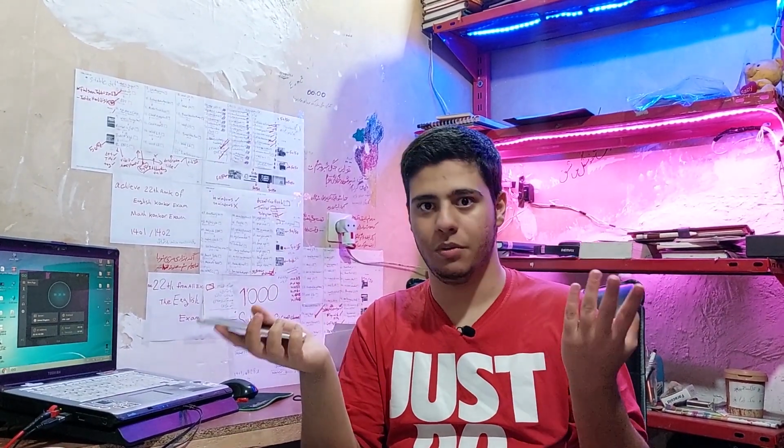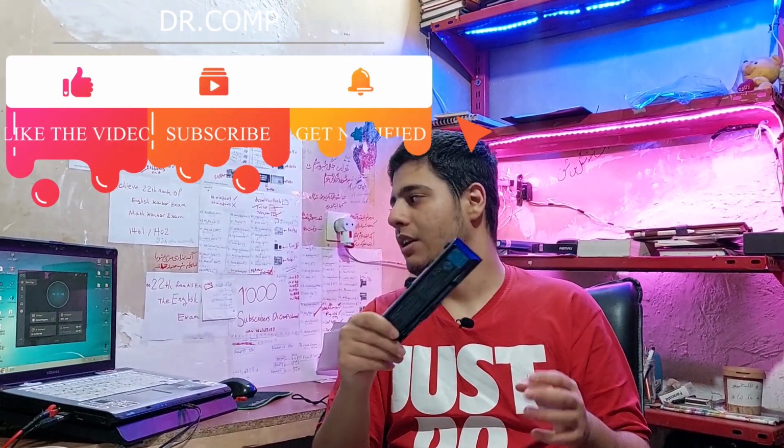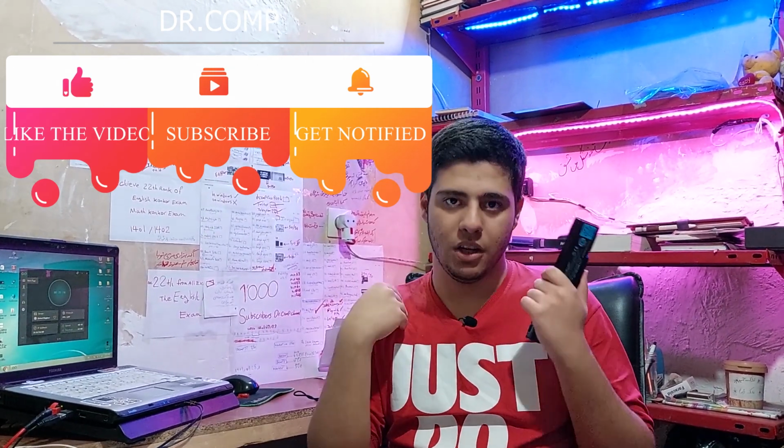I recommend you to have it at least 70%. This is my advice and my recommendation, but 50% is good for that. I also recommend you use a laptop which has a battery. When it powers off and something like this happens, your flashing process doesn't get damaged and nothing happens. This is my advice too. Let's jump to the screen and see what we should do.